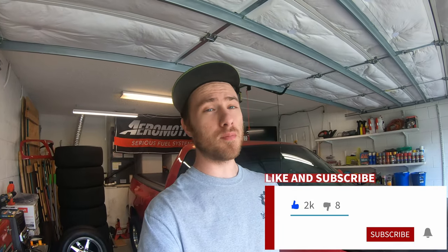What's going on YouTube, back here with another video. Today we're going to be doing a mod to my truck, and I think this is one of my favorite mods to do to these trucks and it's often overlooked. We're going to be installing a valve body in the built transmission. A valve body is pretty much a shift kit — it'll really firm up your shifts, cut some ET because the time between shifts is less, and also reduce the wear on your clutches and the heat your transmission produces.